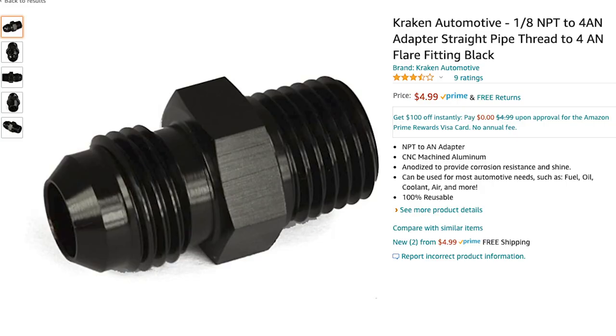For the drain, this is a tricky one. You can use a T3/T4 flange to 10 AN underneath the turbo, and it'll come with a gasket — you can find it on Amazon. For the feed line, I used a dash-4 AN to 1/8 MPT because the Mishimoto oil filter sandwich plate takes a 1/8 MPT fitting. You'll need an adapter to convert the 4 AN line to 1/8 MPT. At the turbo, you typically want a 90-degree bend so it doesn't kink. These are all readily available through Amazon.